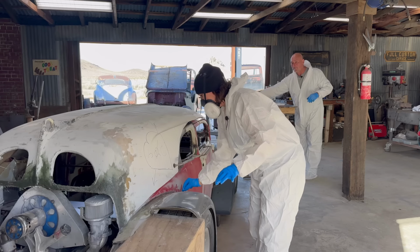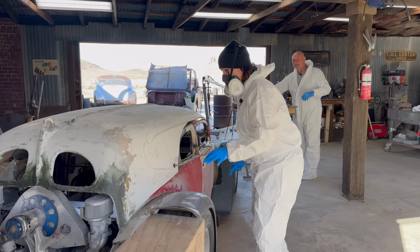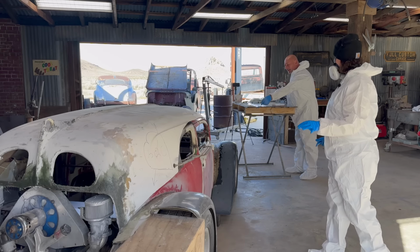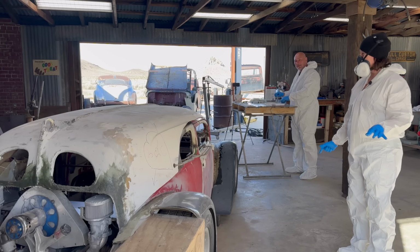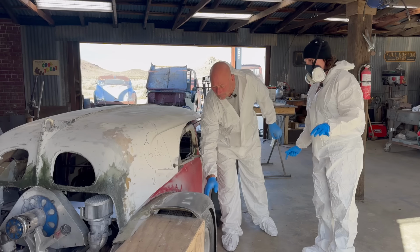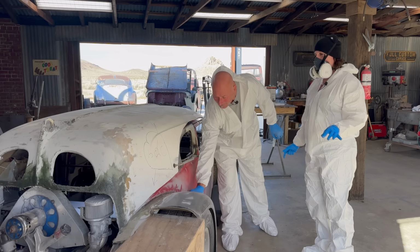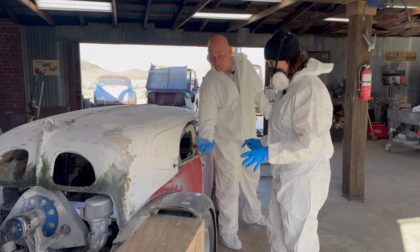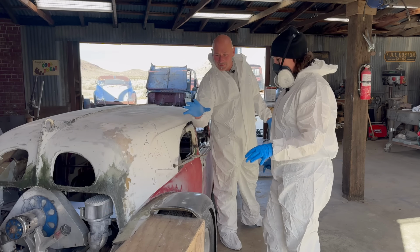Are you trying to get these even? That's the whole idea. You're looking to grab on the black fender where I sanded it back. You're looking to grab from that scuffed area. This means nothing for the fiberglass, it's all in this area. So on the gray, this part. Yeah, because that's all scuffed up, and that's called putting a tooth in it. So it's all scoured, so the material grabs.